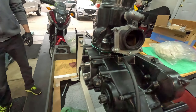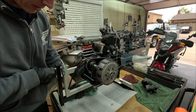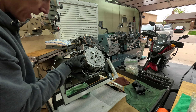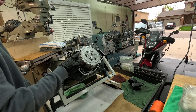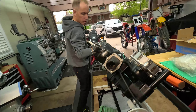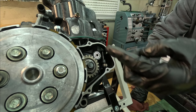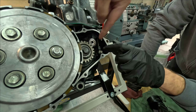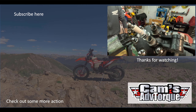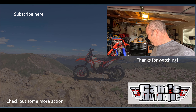It's nice having it on the stand like this because you can set it at different heights. All the new bearings came in good — way better than they were before. Everything went in really well. There's the new bearing here — this is your water pump drive — and this is the one that spins the whole power valve. I torqued them to about 21 foot-pounds. Sweet.